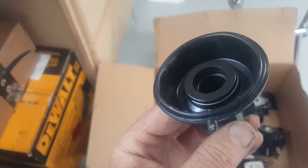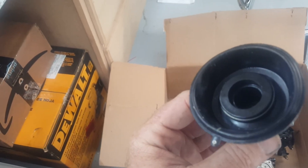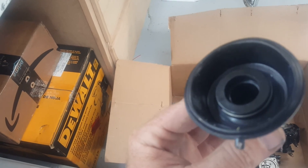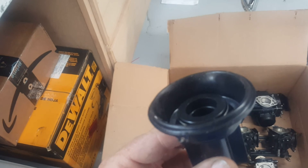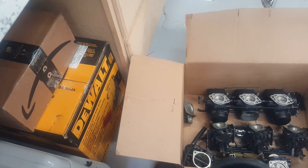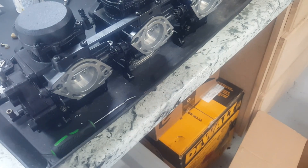You must make sure those plungers are operating correctly first. Then go ahead and re-jet your carburetors: drill your plugs out, turn them all the way in and lightly seat — don't force it because you'll destroy the needle — then back them out a quarter turn. Change your low speed jet from a number 35 to a number 50 and you'll be amazed at how good it runs. Hope this helps.